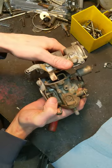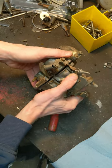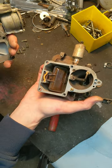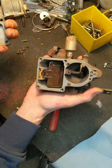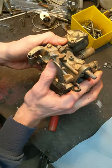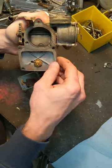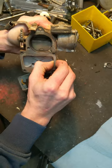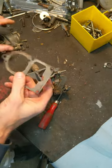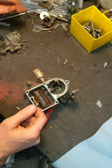So this obviously, when I pulled it apart, just split apart. When you go to put it back together, you have to make sure that you bring these levers back or else it'll have problems. There is what looks like a brass fitting — it's either a locating pin but it looks like it flows fuel through it, so it's probably a metering port of some sort. You can use that to help get your alignment and also when you reassemble. The gasket's stuck to the top in this case, so I'm going to end up ruining the gasket pulling it off. But when you reassemble, just put the gasket on and it'll be easier to have it lined up by that.